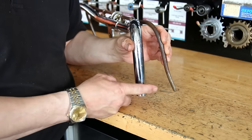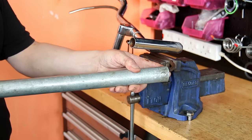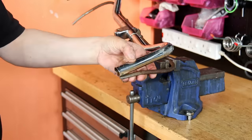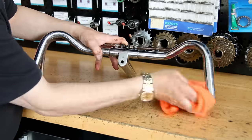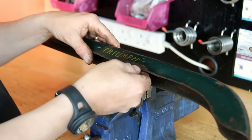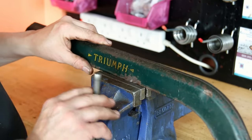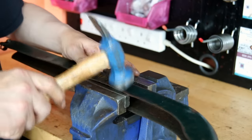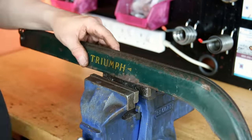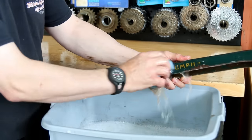We also had a bent brake lever — normally they touch in the centre of the handlebars, but this one was way off to one side. So I'm bending it back into its correct position right in the centre so it's put in correctly and you're not going to twist off to one side. We also had a very ruckled chain guard with the original Triumph logo — I'm shaping that back to bring it closer to its original form.